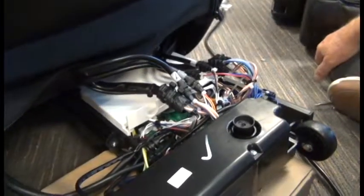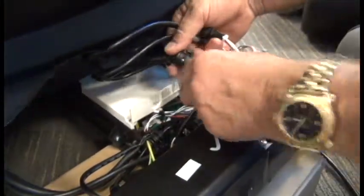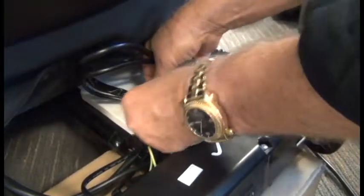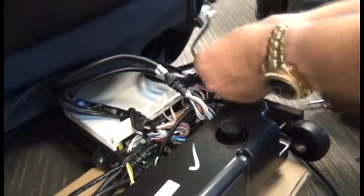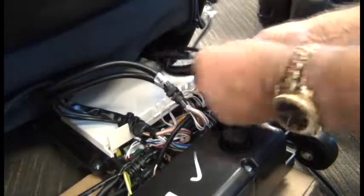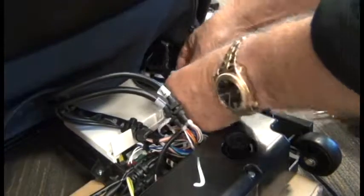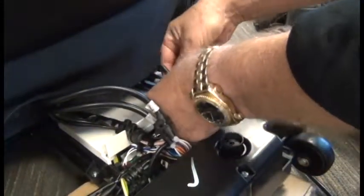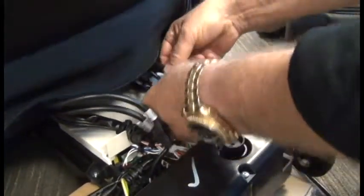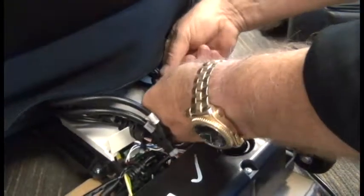Once the rear PCB cover is secured, we're ready to start aligning the strain relief on the cables inside the slot. So let's start with the large one, which obviously goes in the largest slot. And then the rest of the cables are numbered 1 through 7. So we're going to start with cable number 1 on the right-hand slot, and install each cable in numerical order, moving from right to left.